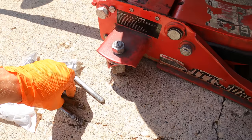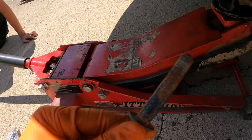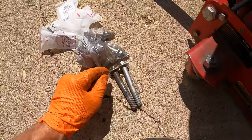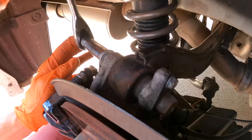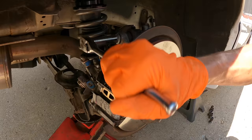Now, since this is a Honda, we're going to grease our suspension hardware, because they're known to rust away and become one with the bushing. And then you have to grind it off, cut it off, you name it. So we just grease the inside there - not greasing the threads. We didn't have the correct hardware for this bolt in particular, but we do have the correct bolt for the other arm. I don't usually like to impact bolts on right away - I like to install everything nice and loosely, make sure it all fits correctly, and then crank it down. Since we have the suspension loaded already, we can go ahead and tighten everything. Because if you tighten everything with the suspension fully drooped, when you lower the car down on the ground, it's going to prematurely fail your rubber bushings. So make sure you load your stuff before you crank it.